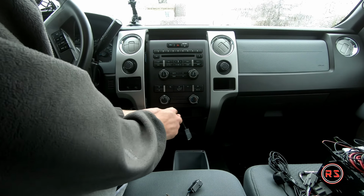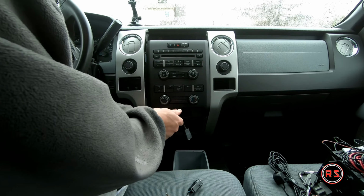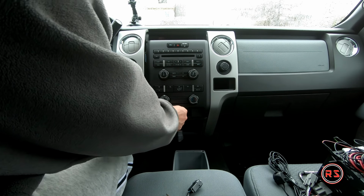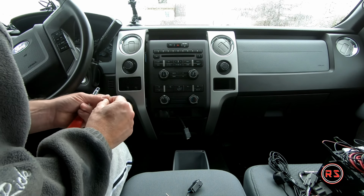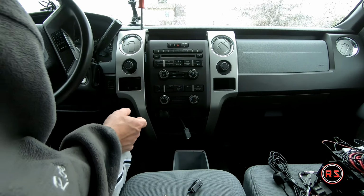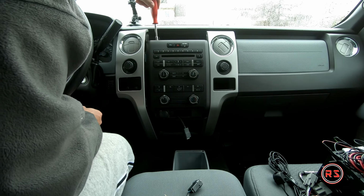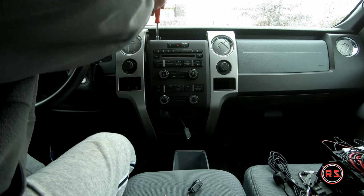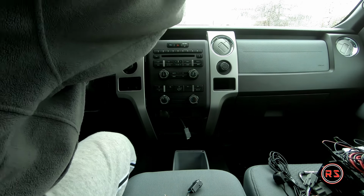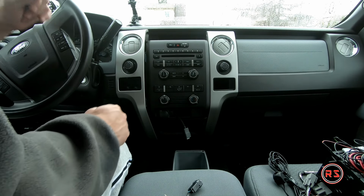Some use a power tool for that. I don't like using power tool in plastic because just a tiny bit too tight and you just ruin your thread. Now you're screwed. So I'd rather use conventional tools and be a little safer. Obviously, if it was a full-time job, I would probably use a power tool as well. So this is it for the screws for now.